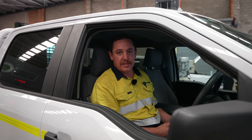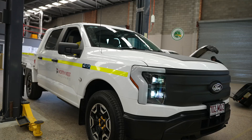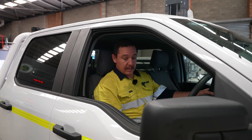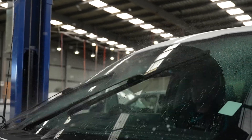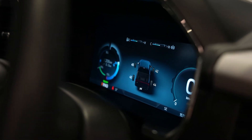As you can see, we've driven it on the hoist. A lot of this service stuff is just like an internal combustion engine or a normal car, as a lot of people would say. We'll start with doing a light check — making sure indicators, headlights, brake lights, and park lights work. Make sure the horn works, go through and check the windscreen washers and wipers. Make sure there's no faults on the dash and no tire pressure issues.